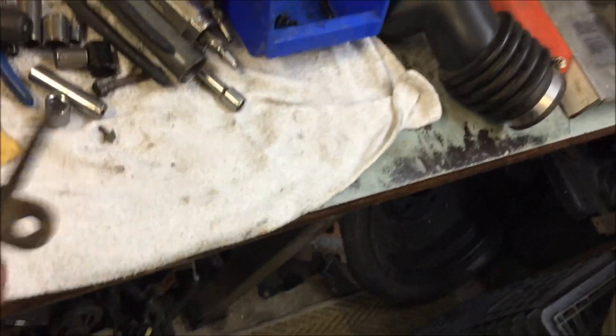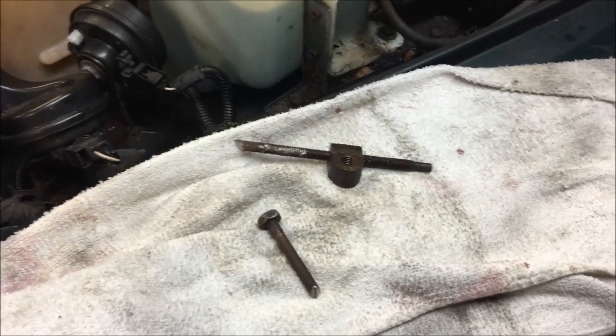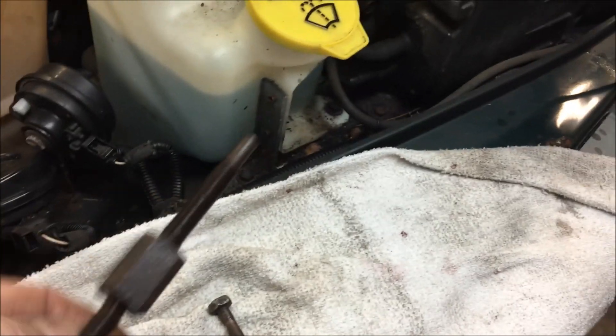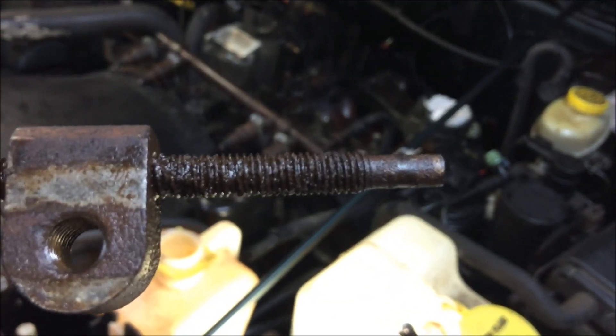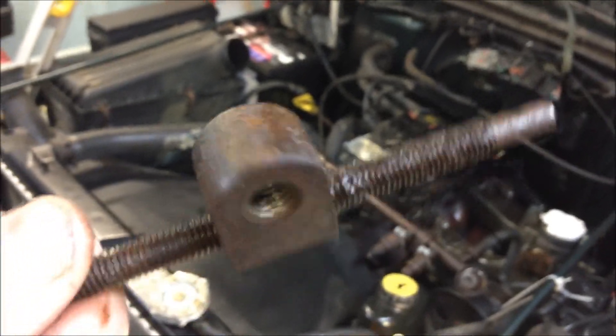So far it's not too bad, nothing here is really tricky or hard to do. About that tensioner I had to order — I ordered it from Extreme 4x4 or something like that. It's like seven or eight days later since I ordered and still haven't received it. Their website said three to five days, so that's bull. This thing was all pretty rusty and I couldn't get it out no matter what I did, so I basically cut it with the grinding wheel, took it off, and I'm going to replace it. That's why it wouldn't adjust anymore — just all rusty. I got it hosed down with WD-40 but it still didn't matter.